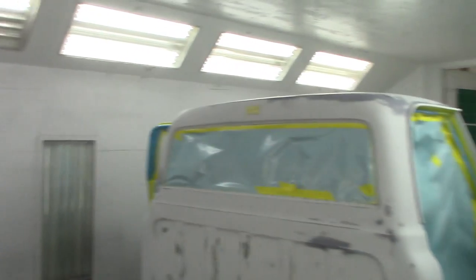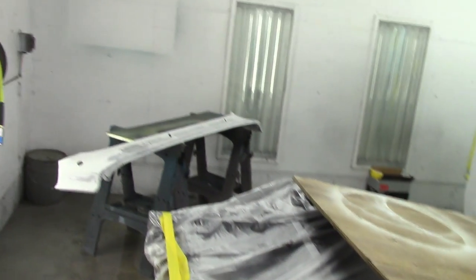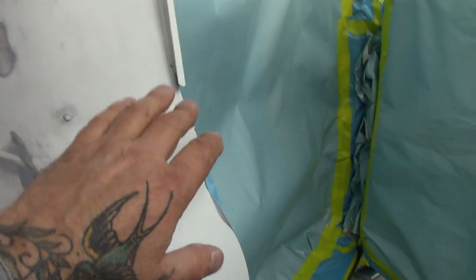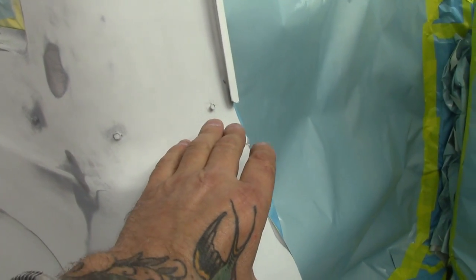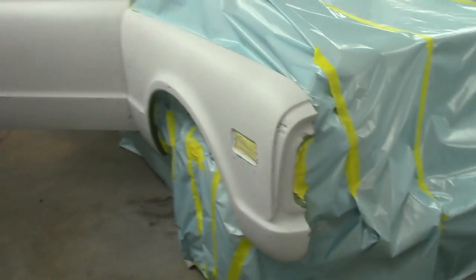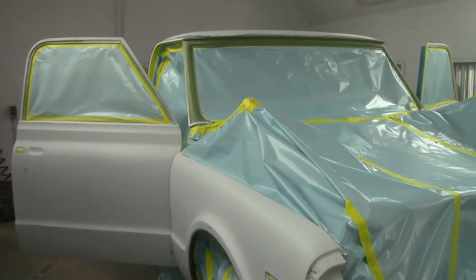I've got the truck in now — she's all masked off. The cowl's over there. This truck has got a white roof, so normally we don't tape here because you're going to have a hard line. It's a base coat clear coat, so we spray the base of the white, do the whole roof, let it dry up — a couple hours, maybe an hour and a half — then do our tape work, cover the roof, spray all the green all the way around — fenders, hood, everything. Then pull the masking off the white and clear coat the whole truck at once. That is what's going to happen here tonight.